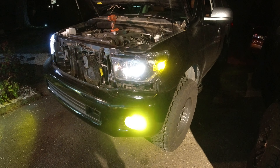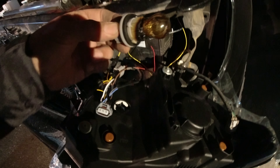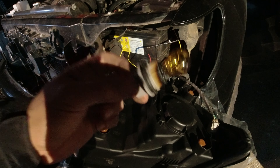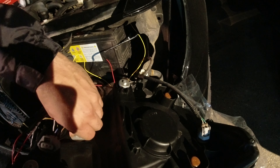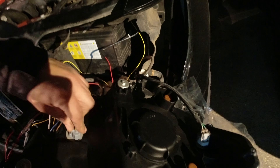The blinker does not work — that is a no go on the blinker. One thing I forgot to do was pop in the old blinker from the old headlight — duh. That's a 2157 amber bulb and you can get these in LED, which I think I'm going to get, but it's getting pretty late and I don't have time to go to the car parts store. So let's just pop this bad boy in and lock her down for now, then we can connect it. Now that should pull enough draw to keep the blinker from hyper flashing. Let's pop the headlight back in place and see if the blinker works correctly.